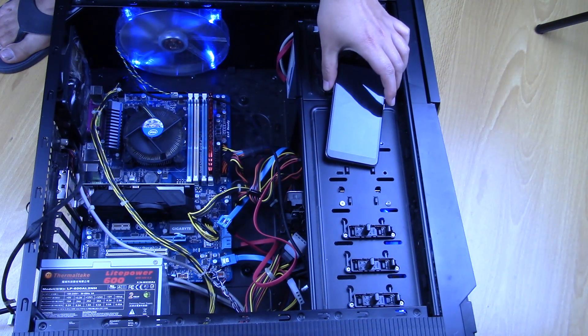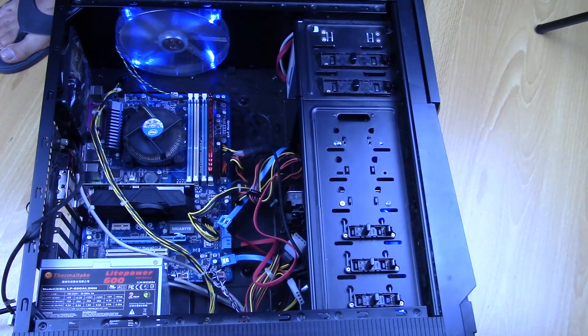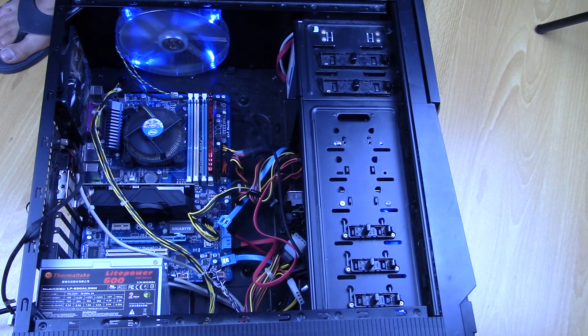Okay, so you can see that it's been going for an hour and 55 minutes and it has not stopped running, which is very interesting. So I'm now going to turn it off and turn it on again, and if it can stay on this time then we can declare the problem as fixed just by removing three slots of RAM.